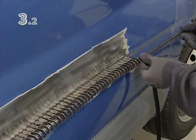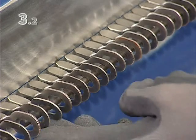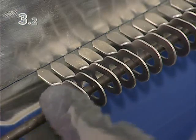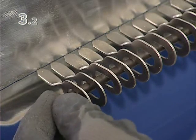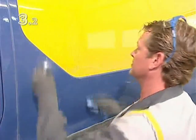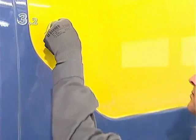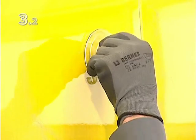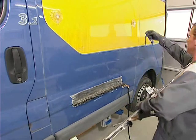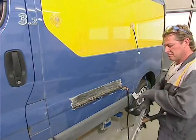From both the right and left-hand sides, insert a pulling bar through the openings of the pulling eyes. As the long pulling bridge is used for large damaged areas, suckers are applied to hold the retaining straps of the pulling bridge.